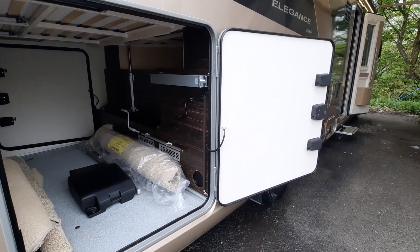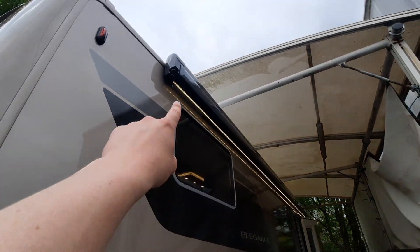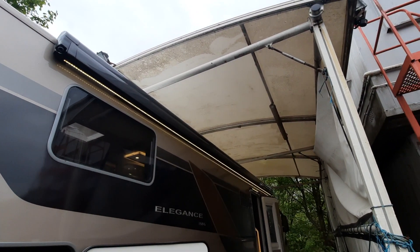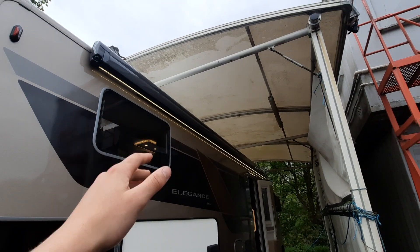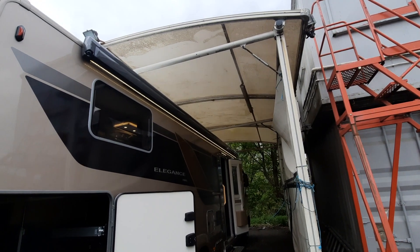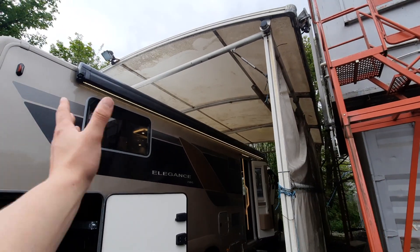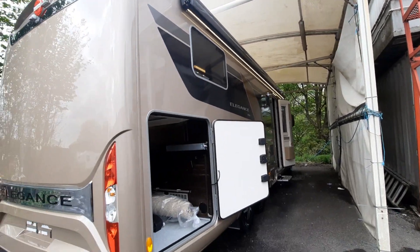Your awning is a Thule awning. Connect the awning pole to the T-point, push it in and turn it halfway to lock it in. Wind the awning out to a height you can reach, then drop the legs to take the weight. Continue winding until it's fully extended — approximately three metres. Bear in mind: if it's windy or the weather is bad, take the awning back in, as it acts like a large sail and you don't want it snapping or coming off.